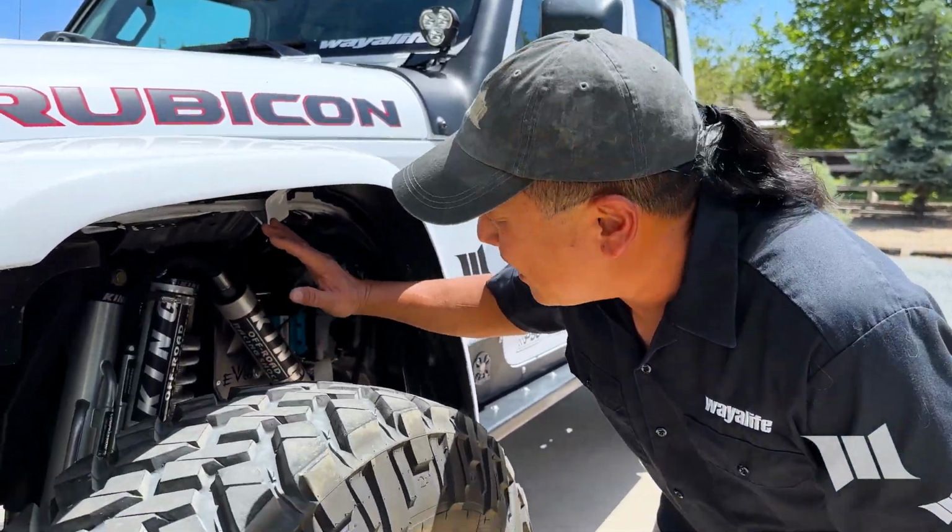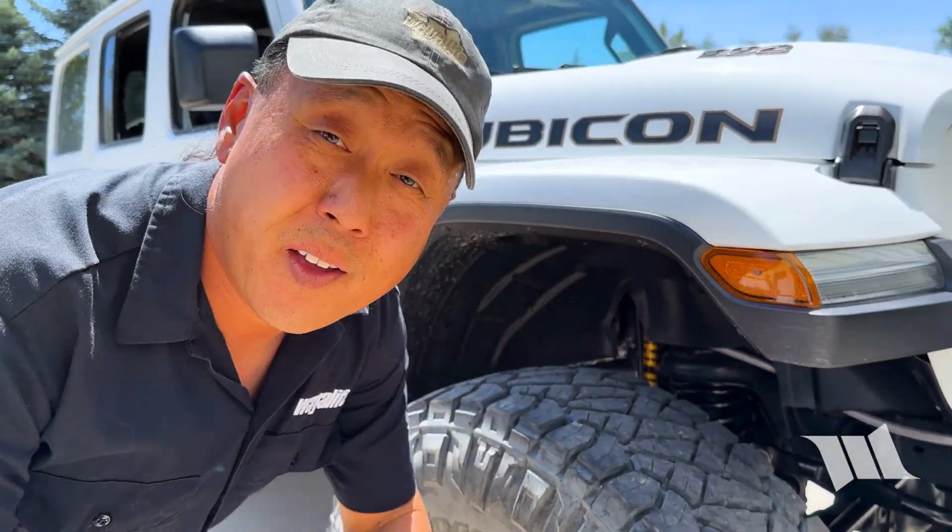And because I know it's coming, Ohlins is not trying to be or even compete with something like a double throwdown system. But I do think they'd give a lot of standard coilover setups a good run for their money, and maybe even offer a better ride. Sure, a coilover system will give you more travel, but they require you to install new brackets, they're typically run with long arms, and they definitely require a lot more labor to install, which means they're a lot more expensive. Being that these are bolt-on shocks, they're effectively an upgrade to whatever standard lift kit you have now.